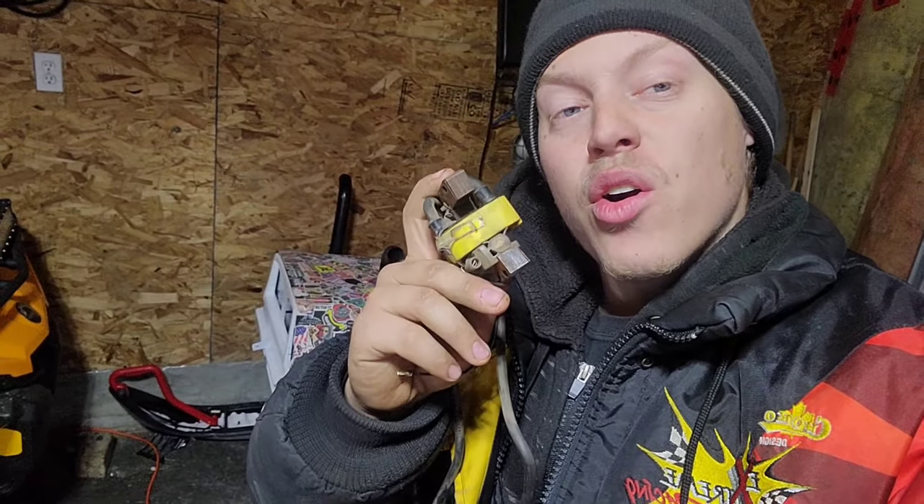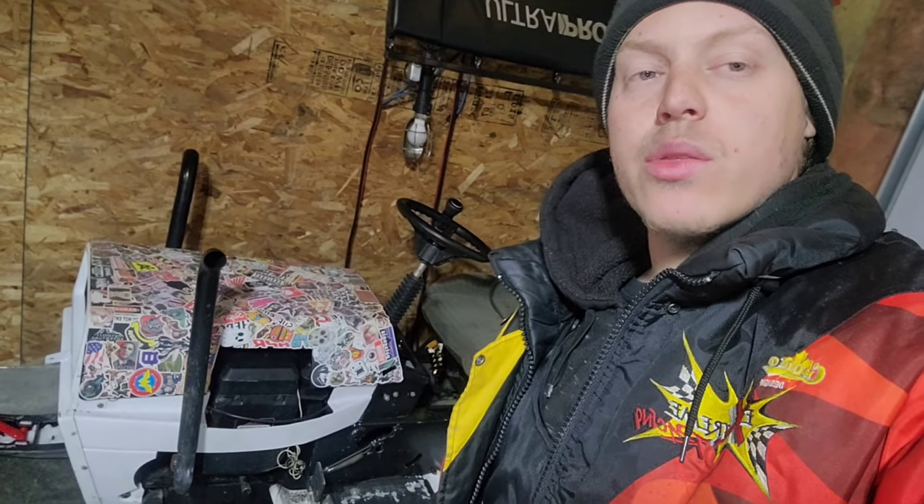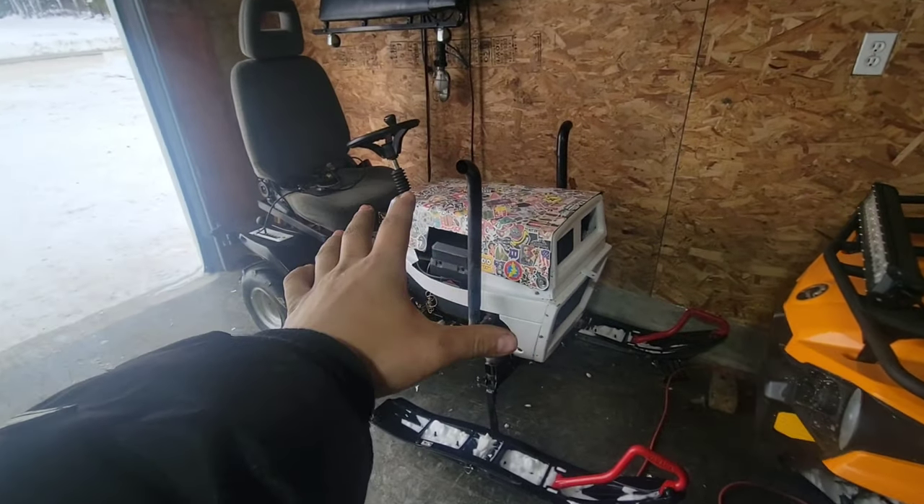The stock coil from this mower was faulty. A brand new coil from my local tractor shop — also faulty. Turns out Remy has the same engine in one of his mowers, so I asked him if I could borrow his coil. He said yes, I tried it, and it started right up. So finally guys, it's actually time to test this in snow with the skis. Let's warm up this little bitch.